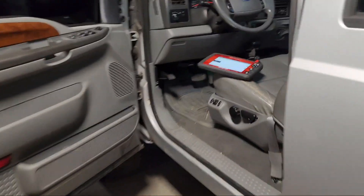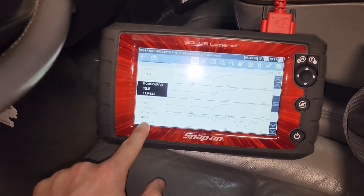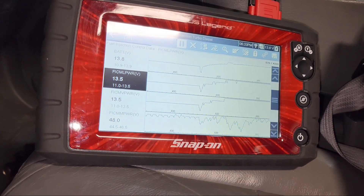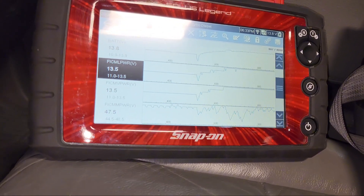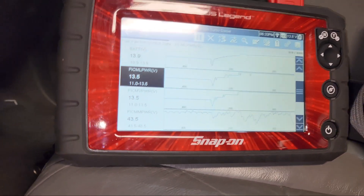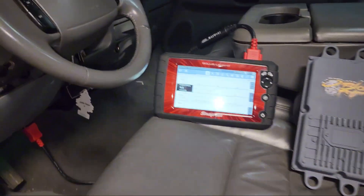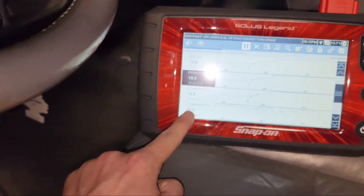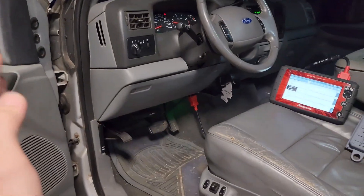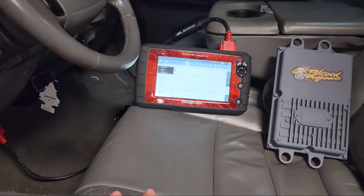I'm not going to rev it too much because it isn't fully warmed up, but I'll start to give it throttle and watch that lower number. As you can see that was dropping down to 45, and now whenever it warms up the idle will slightly change and it'll kind of smooth out some but I'll still have that hesitation range. Let me shut this off - even after it gets up to full operating temp I'll still have that hesitation range.